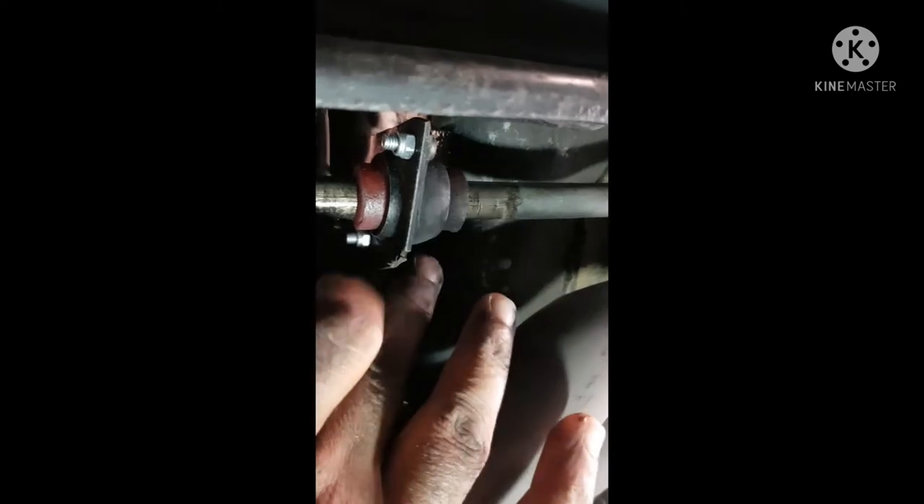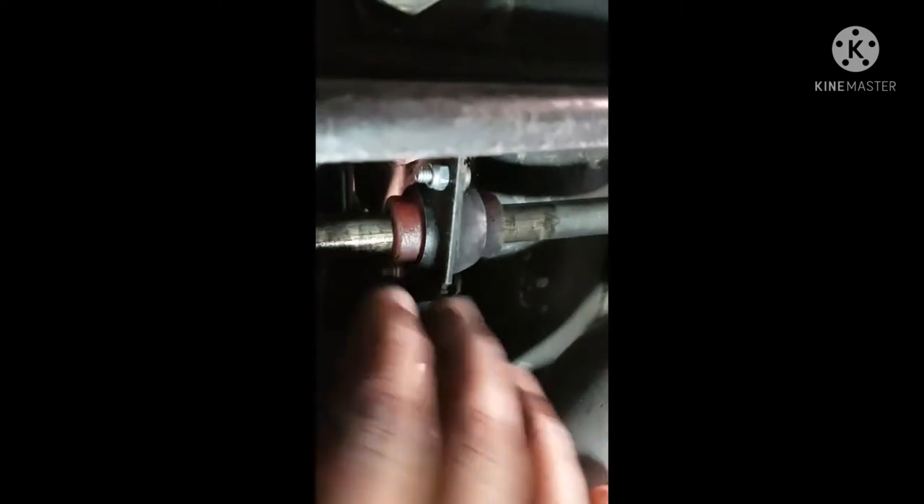Okay guys, this is towards the front — there's a shaft going to the lever back there. Comes to the front. So firstly we've got this bracket here with the bushing in there. You need to make sure that all your bushings are good. These bushings were replaced recently but we've already got some play in it. It does have play.